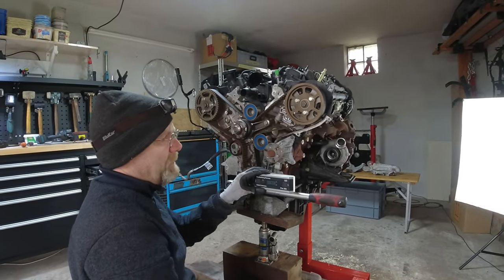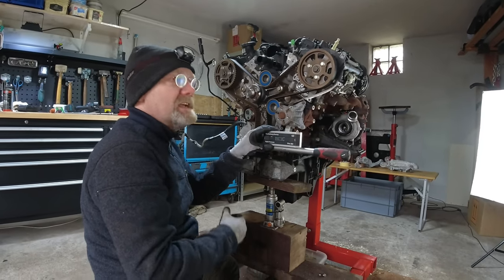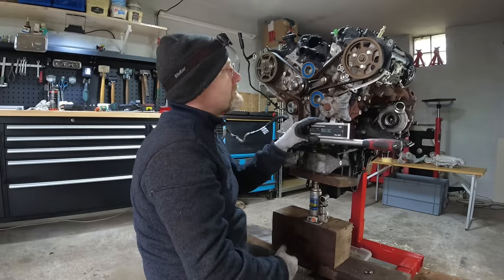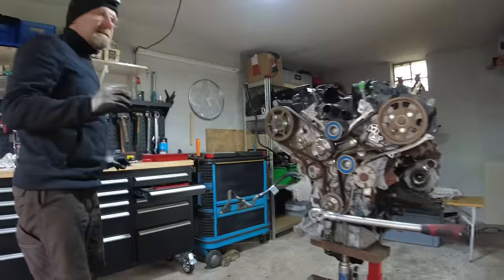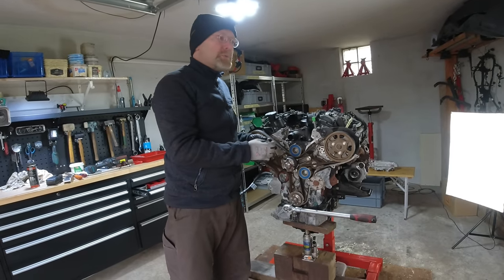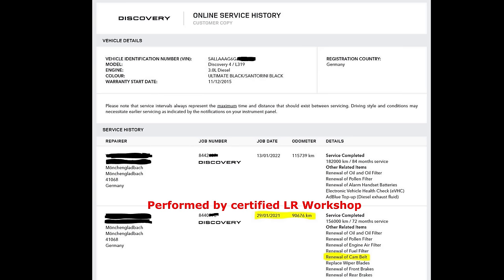Is it critical if your timing is four degrees off on the camshaft? Could that shorten the life of an engine? I don't know, but the timing is clearly not right. This was obviously a really bad amateur job. I'm going to find out if it was a Land Rover workshop - the new plastic riveting suggests it was, and these are definitely OEM parts. But the other view is it could have been a DIY home mechanic who didn't know what they were doing.